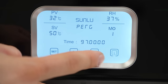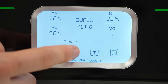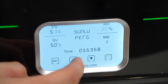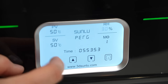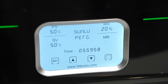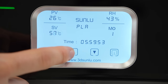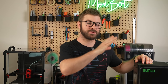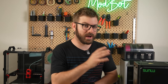For the modes, mode one is the default time-controlled mode — the dryer runs for the duration of time you set and then turns off. For mode two, it uses the time you set at first, then uses the humidity setting to turn on and off, maintaining a value less than your target humidity. I don't mind the screen, but I don't love that anytime you touch anything on it, it makes a fairly loud beeping sound. Luckily, once you have your temp set you shouldn't have to mess with it much, but I really wish they had included an off option for that beep.